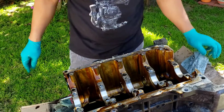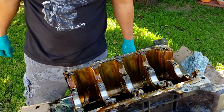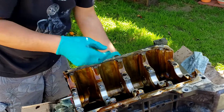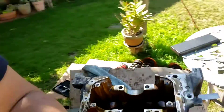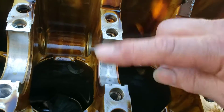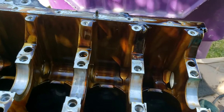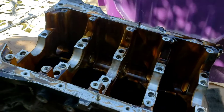The crankshaft — I just need to have it polished, or maybe I'll just polish it myself. I think I'm within spec. Hopefully my bearing clearance is not at the max. And look at this — I think it's already damaged right here. I'll just file it. I'm finding more and more damage — that's from the bearing tabs. I guess it is spinning. Maybe the bearings are worn out. One thing I can do is use my bore gauge — I'm gonna check if it's egg-shaped.